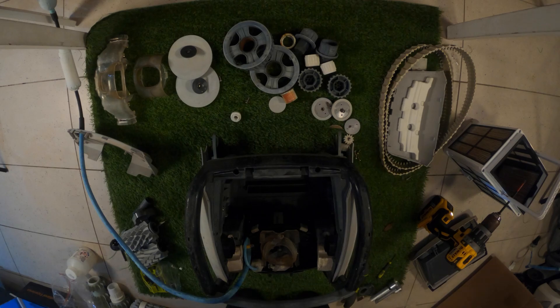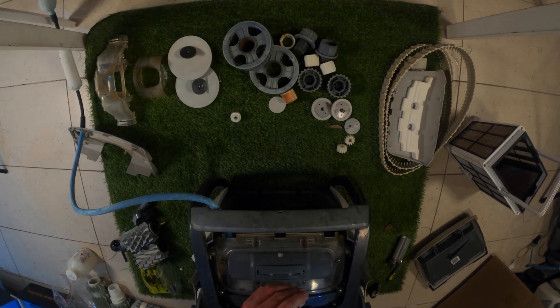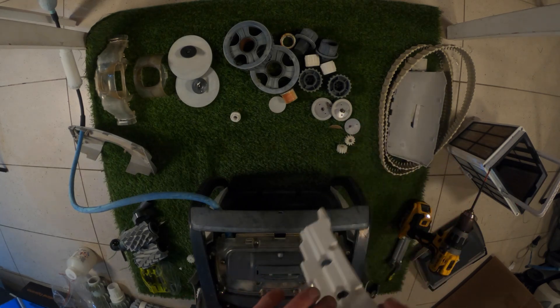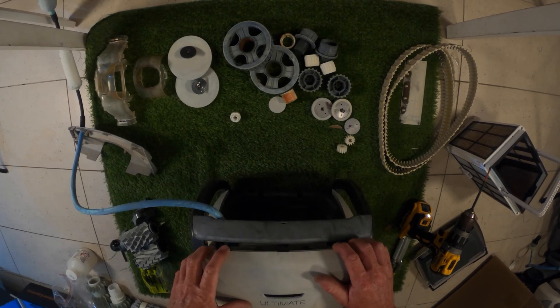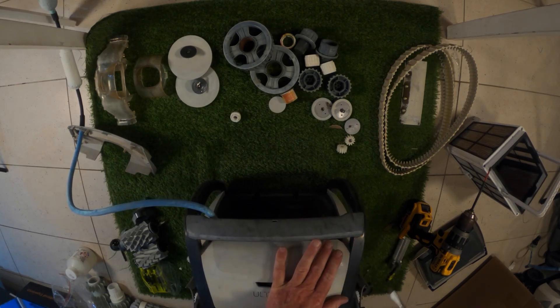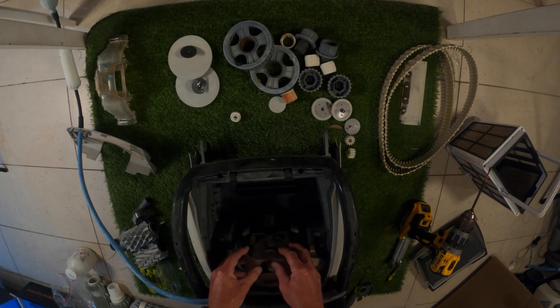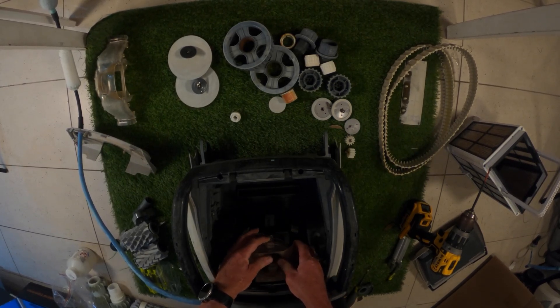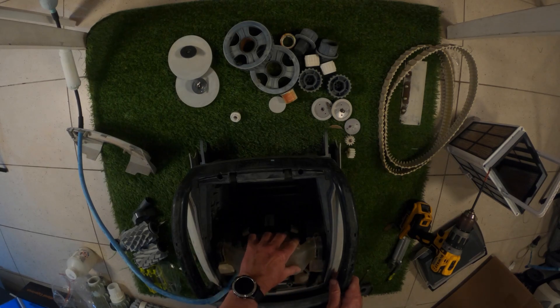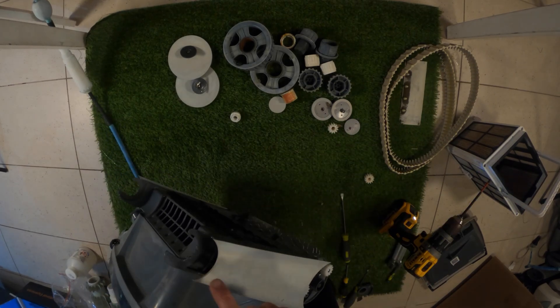We just need to put the LED on — not all of these models have them. There's a little keyway so it fits in, hand tight is okay, just snug. All the screws here are the same size. Then carefully put the foam back in place and the cover — it has a few little notches that you need to carefully line up. You can use a small screwdriver to guide it down. Then put the motor assembly back — this part diverts the water either way and only goes on one way, as the clips are different sizes on either side. Put it on the back first and then push it on the front. Two more screws, then we'll do the rapid drain flap.